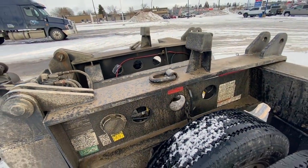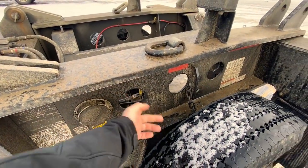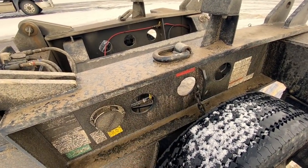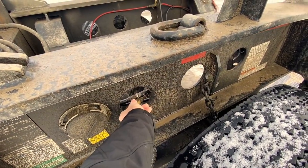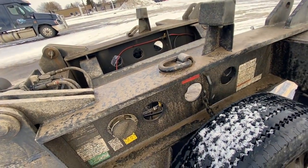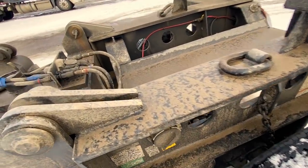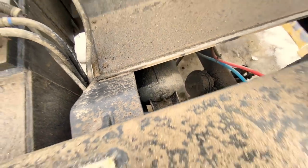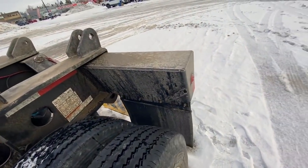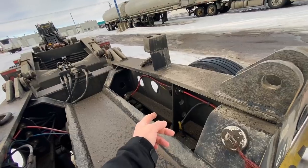So that's the problem. I talked to Fontaine and asked what position these taps should be in, because as soon as I do this — well, there's no air in the system since the truck has been sitting for a day — but as soon as I put this down, the airbags start inflating. That's the override. You don't want that. Ideally, all taps should be at 90 degrees.